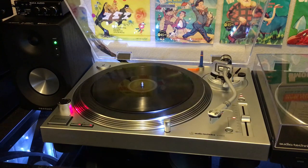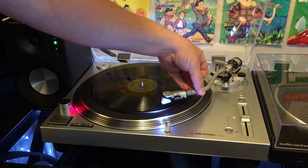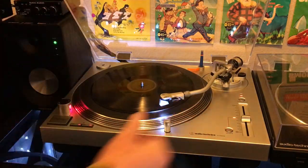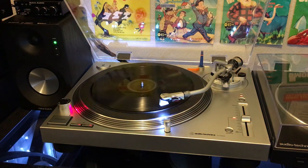This wide groove stylus is going to fit the groove snugly and it's going to sound better — you'll be surprised how much bass we really get out of this thing. We're going to be listening on the Audio-Technica LP120X USB, quartz locked at 78 RPM. This record was recorded at 78 — some old records are actually 80 RPM, but we're quartz locked at 78. I have deep cleaned and demagnetized the record, and we are using a Crosley carbon fiber platter mat with Crosley S100 speakers. We are tracking at two grams, which is exactly what Ortofon recommends for this cartridge.